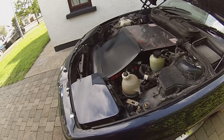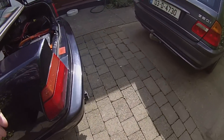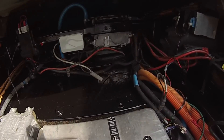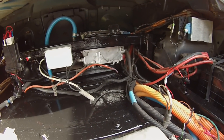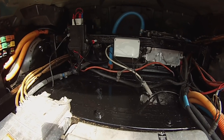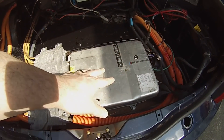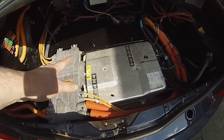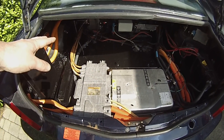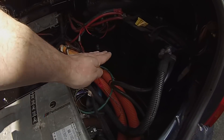Down the back we're on the final furlong — most of the painting is done, most of the metalwork is painted. Things are just roughly held in with cable ties for now. Tomorrow I'll tidy that up properly, put some conduit in, then lift the on-board charger and high voltage junction box, put a plank of wood across so I can do seam sealing and painting underneath, then drop everything back down.